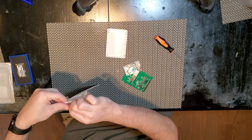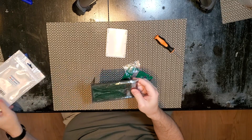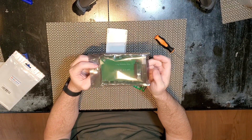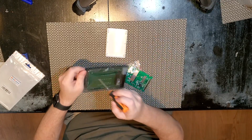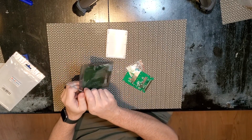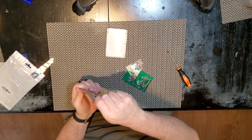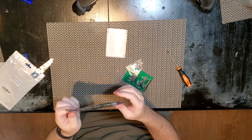Last — and this is something I haven't seen until recently, although I'm sure they were available — this is a really nicely set up 3.5-inch to 2.5-inch adapter for 44-pin IDE to 40-pin IDE. The Ultra 5 or Ultra 10, if you're not familiar, do use 40-pin IDE with a relatively crappy IDE controller, but it does work. Fancy unboxing techniques here on this channel. If I did a better job opening the bag, it would be easier to get it out, but you can't have everything.